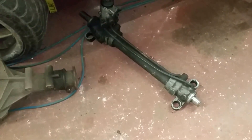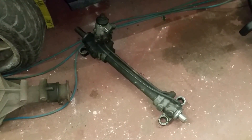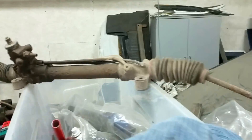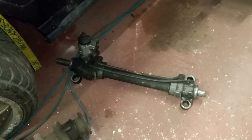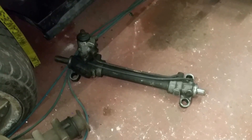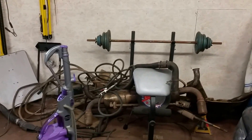There's the front diff — I've got to get that cleaned up and ready to go back in as well. Next to that is the right-hand drive power steering rack, which I'm obviously going to need because I've got a right-hand drive vehicle and it was a left-hand drive that I broke. So basically I've just got to take a few bits off of that and I'll be using that one. I don't know if it's got any leaks — I bought it off someone through a forum ad. I'll give it a clean-up and check what I can, but I won't really know until I start pumping high-pressure fluid through it. I'm going to have to make up new pipes as well, obviously, but that's not really an issue other than cost.